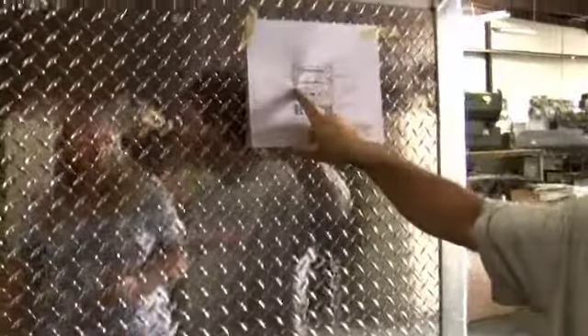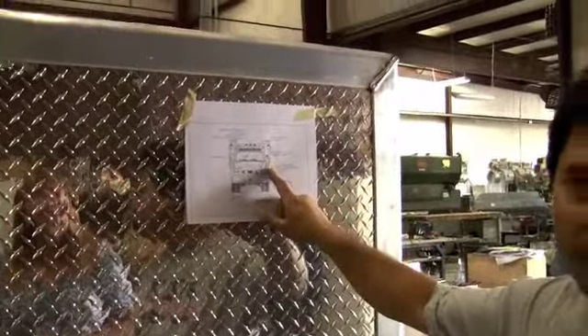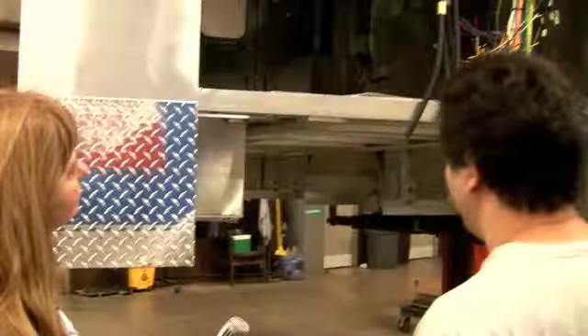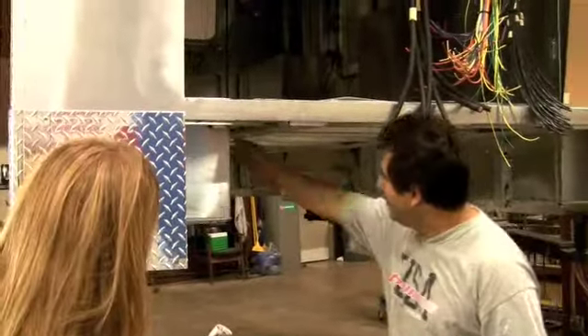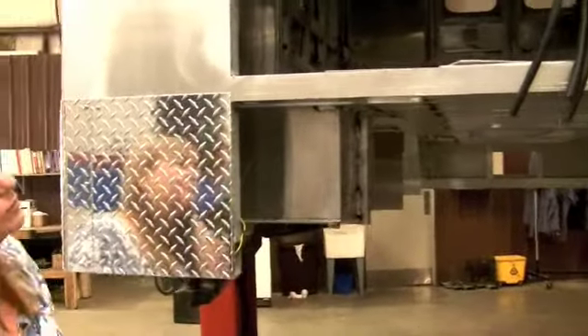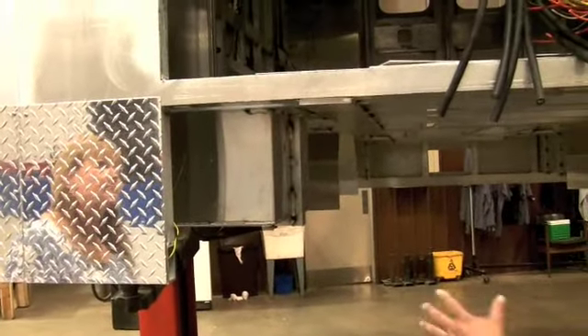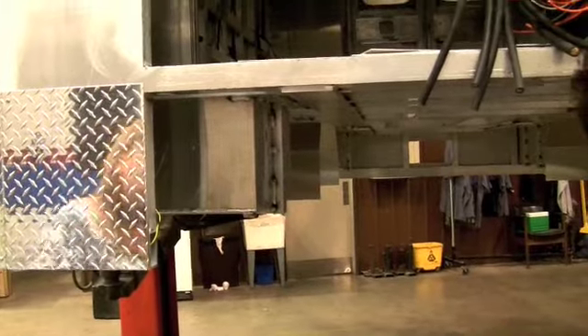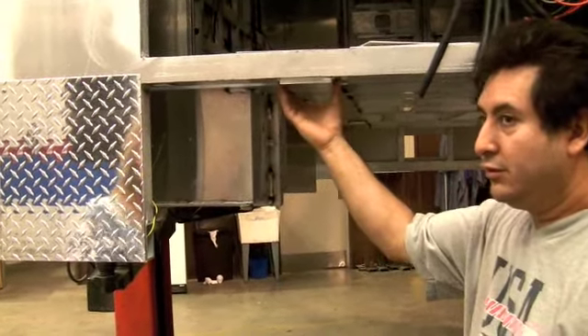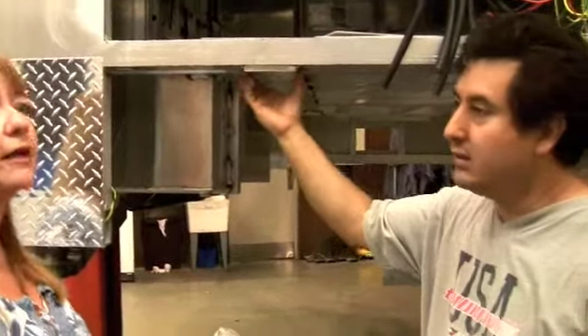What they're going to be in the front — you can put your reinforcement in the front, mind your flat bars, and your ties in the front, so it's very important. So this is the front of an ambulance. The lift is where we install all the reinforcement for the compartments, and we make sure all the bottom is welded properly, because that's pretty much what's going to hold it through the mounting. These are the mounting parts — they hold it to the chassis.